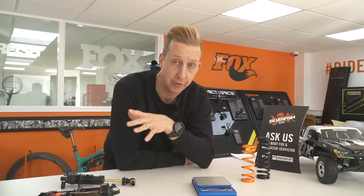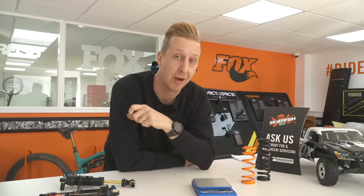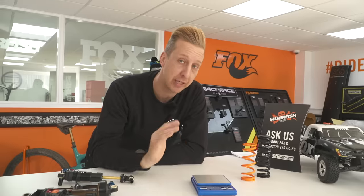You don't tend to get a climb switch on quite a lot of coil shocks. On the more expensive ones you can, but even then not all of them. It's a retrofittable thing, meaning having the shock customized. On a coil shock, arguably on a trail or enduro bike, you're going to want that feature even more than on an air shock because it's so much more active. Just think about pedaling a six-inch travel bike that weighs 32 pounds uphill all day, the thing bobbing up and down because it's such an active shock. Take into account different riding styles and bike designs — if you've got a bike with loads of anti-squat, it might be okay because the bike will naturally stand up. If yours hasn't, you're going to be pedaling like a rugby ball. Not ideal.